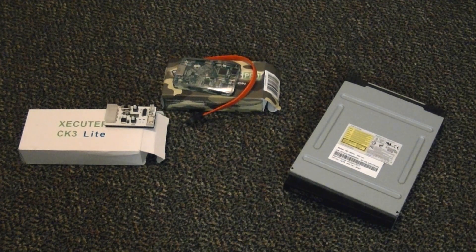This has been asked for a long time, and I finally got another slim to mess around with, which was a Trinity motherboard. So I will be giving you all a tutorial on how to flash a WinBond LiteOn 16D4S. Now, first off, there are two drives — there is the MXIC drive, and there is the WinBond drive.